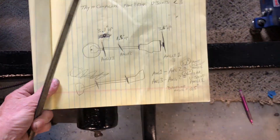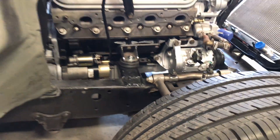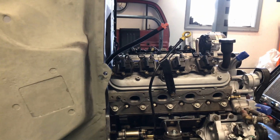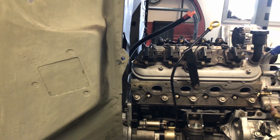When I started this process I had about four degrees of engine tilt and that was just too much. So I ended up having to put two more shims at the back edge of the transmission — right there. I had to shim up that back edge, and that brought the angle from about 4.2 degrees down. I'll show it on the screenshot I took of the app. I had to make an adjustment there and it is all looking pretty good.